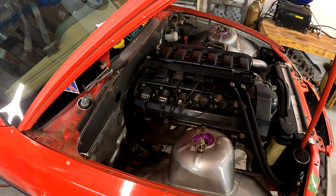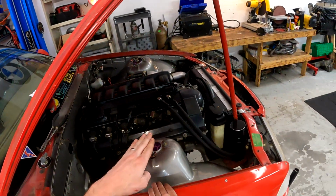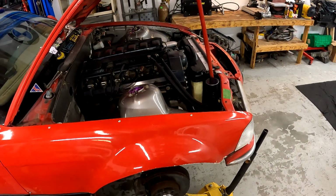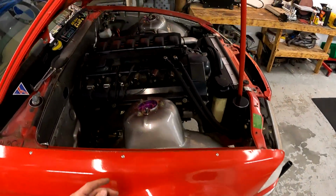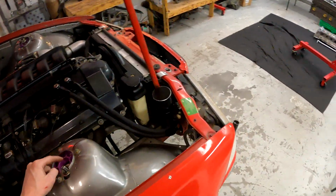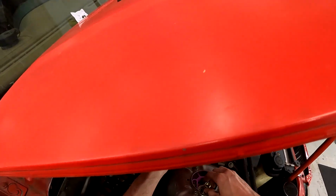If that comes loose, just even a little bit, you're going to have the sensation like your entire strut is bouncing up and down in this area, and you'll think you have like a blown wheel bearing or a loose lower control arm, and you check all the bolts all through here, and in actuality, without a jack or a pry bar, because of the weight of this tire, whenever you jack it up, you won't realize that it's actually this guy just moving up and down.